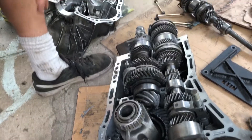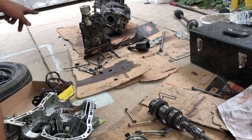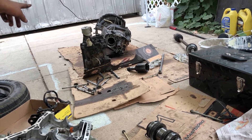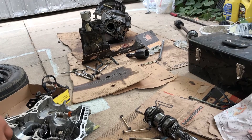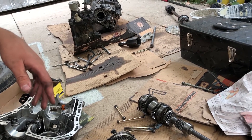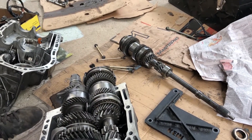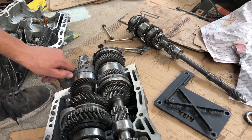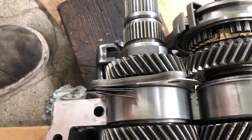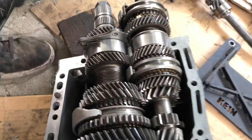That's how the reverse mechanism works. There's also a reverse lockout and other cool stuff on the center diff housing — you can see the center diff in there with more gearing, the output shaft is up there by the glove. There are various sensors: I believe there's a reverse sensor that tells the car when you're in reverse, and a neutral sensor. The speedometer is the one I showed earlier. These shims help tighten things down to get the exact lash — you can add or remove shims in different sizes.